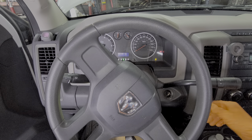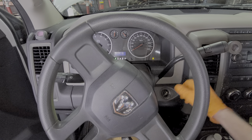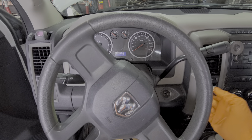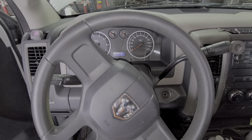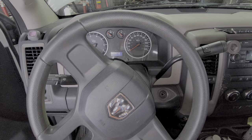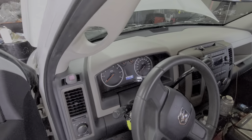To begin with, if your car is not starting or the engine's not cranking, try shifting it into neutral and then starting. These cars have a safety device where unless the computer detects that you're in park or neutral, it will not allow you to start it. Moving on beyond that basic troubleshooting step, we're going to head under the hood.